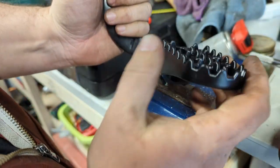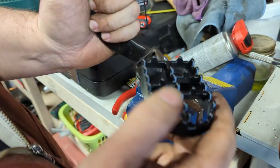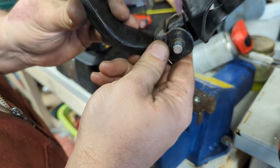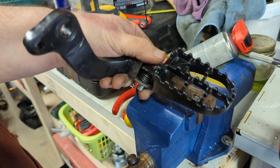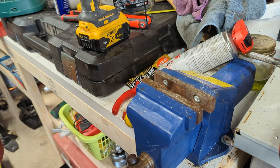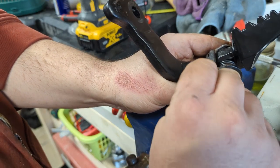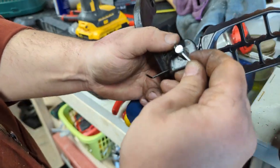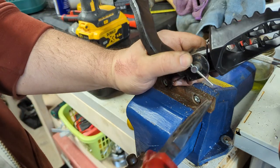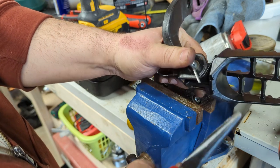So that when you're riding along and you catch something, it can flick up out the way, but it always returns back again. That'll wear in. And then we'll just stick an R-clip on the back, supplied in the kit of dodgy nonsense. Well, they're not actually R-clips on these ones, they're split pins. So in from the most upward facing side in case it does come apart. Rather large split pins for this purpose, I have to say.